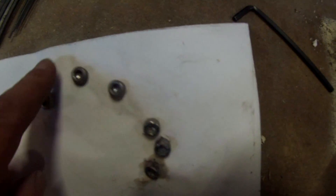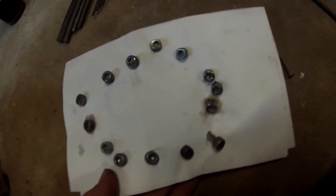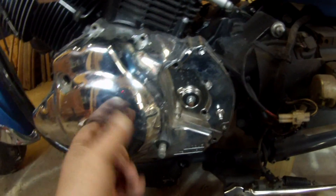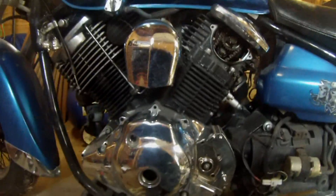Three from the inside, then I'll work my way all the way around. The reason we're doing this — putting them all in order on a piece of paper or cardboard — is because every single bolt is a different size, different in length. You want to put them back in the same order you took them out. I'll know exactly where they go when I put it all back together. We'll probably have to tap it and break it free because there are no more bolts holding it in place. Every single one of them's out — we just need to crack the cover and pull it off.